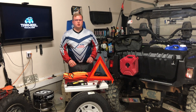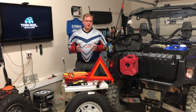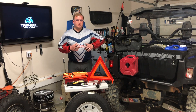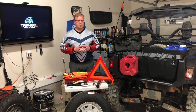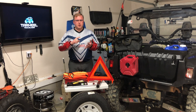Hey everybody, thanks for watching. Today I want to talk about trailer safety, specifically changing a tire on the side of the road. I've had to do this two or three times over the last year, and mainly that's my fault. I found out I had my trailer tires inflated way too much — the pressure was too high and it was causing blowouts.